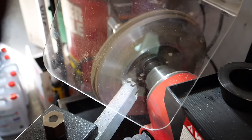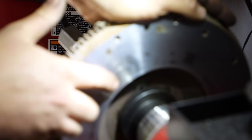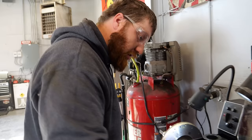There's a big difference already — you can hear those spots it's hitting. There are hot spots where the clutch has gotten hard in the metal. After the first pass you can see the shiny spots — those are where the clutch heated and hardened the metal. You can hear it when cutting: it cuts way slower right there and you can feel it's way higher. We need to do a few more passes until all those hot spots are gone, then we'll have a properly resurfaced flywheel.